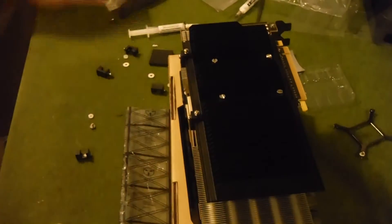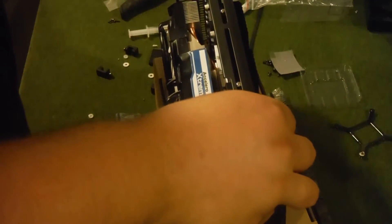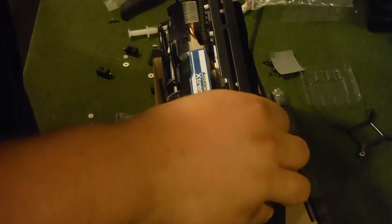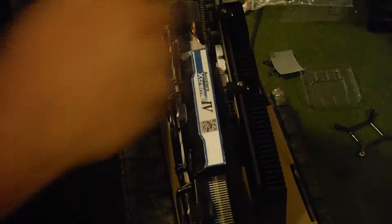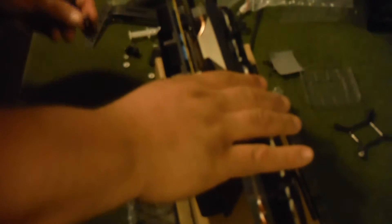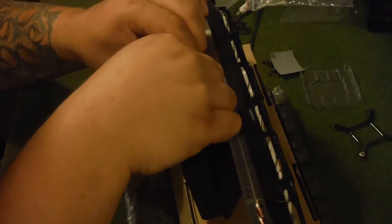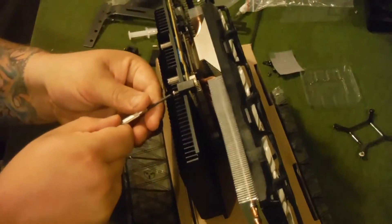After you finally mount the back plate with its compression brackets, the kit also comes with seat clamps that provide proper alignment of the board and the back plate. Something really awesome: try to apply at least two of them to the top so you can mount the bracket to eliminate graphics card sag. Put them about finger tight so after you get it in your case you can adjust it accordingly and screw it in with the four screws. I think it's a really great feature.